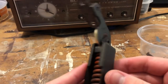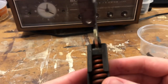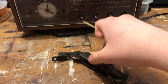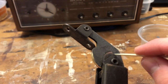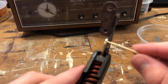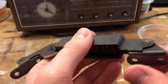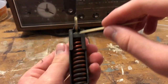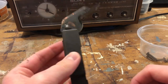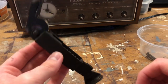I should also mention — in addition to the lid not going down all the way — the lid stay was making a grinding sound on its way down when you move it up and down. That's not right, viewers. So let's see how we're doing on lubrication — I see this thing has been lubricated at one point, back in the day. I'd say that lubrication's gone completely bust. If there was lubrication here, it seems to not be part of this assembly anymore. I don't know how common or unusual this lid stay is on RCA's console stereos.